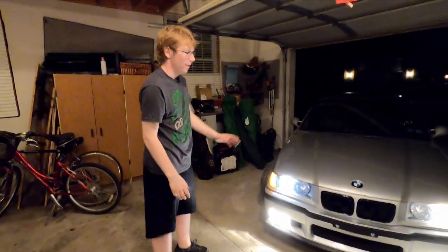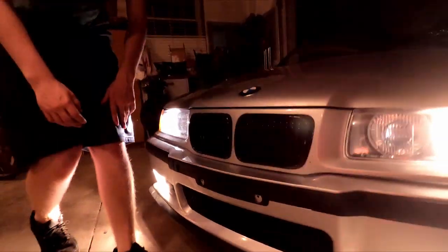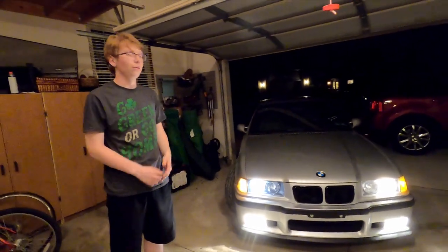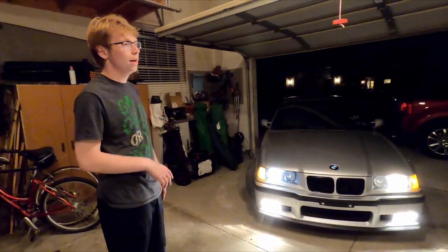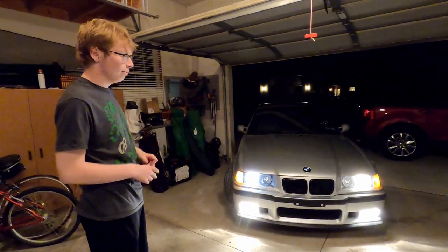After way too many hours it's actually on and it looks pretty good. There's a slight crease in the bumper right here — it honestly took a while to even notice it. The splitter has a slight gap, which could be a mounting issue or just the splitter itself — most people won't notice it, but if you want that OEM look or you're a purist, that's the kind of thing you'd care about. The most painful part of the whole job was the fog light brackets — make sure you keep your old fog light brackets because the new ones they give you are not the greatest.